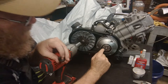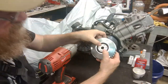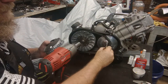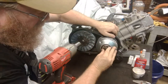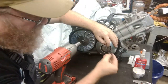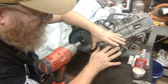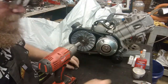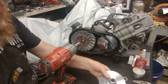Now when you take this one off, remember this one has a bevel. The reason for that is that when the splines on this face plate push down — you can see there's splines right here and splines on the shaft — when you put it back together, you want to make sure you push it all the way down until you feel those splines engage. Once they engage, take that beveled cut, face it in, take your nut and hand tighten it down so you know everything is seated before you torque it. So for right now, let's take that off and set it to the side.